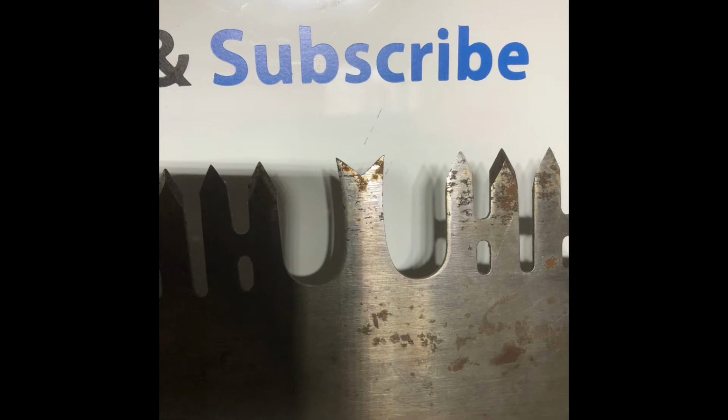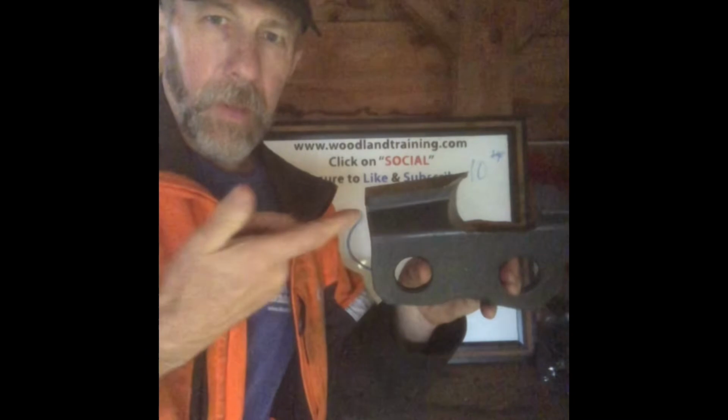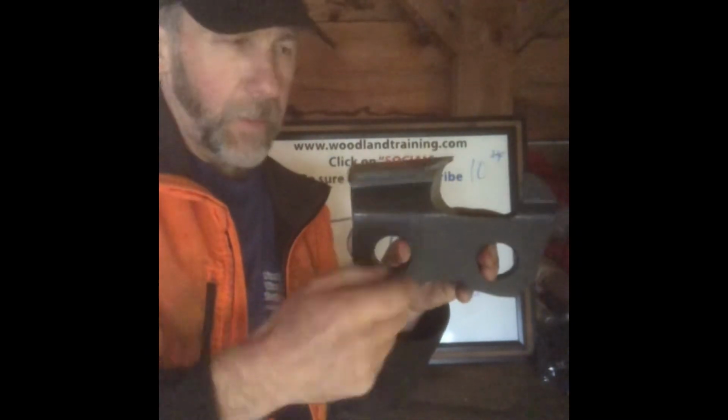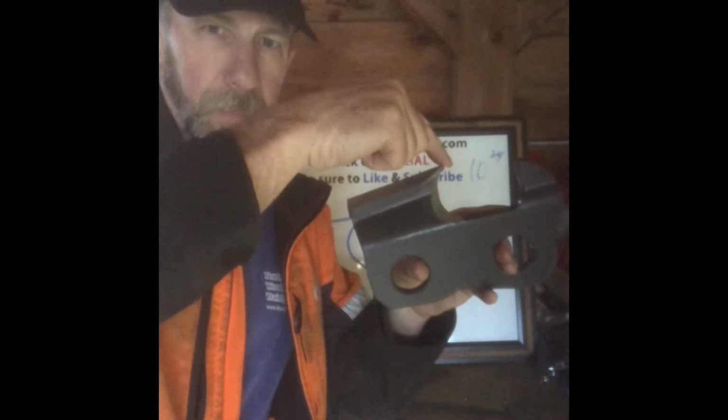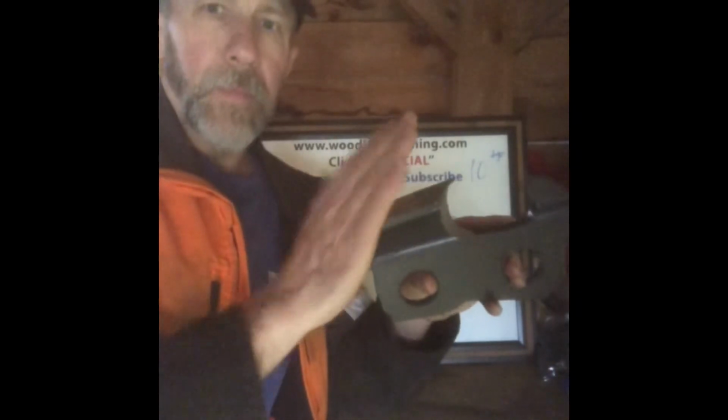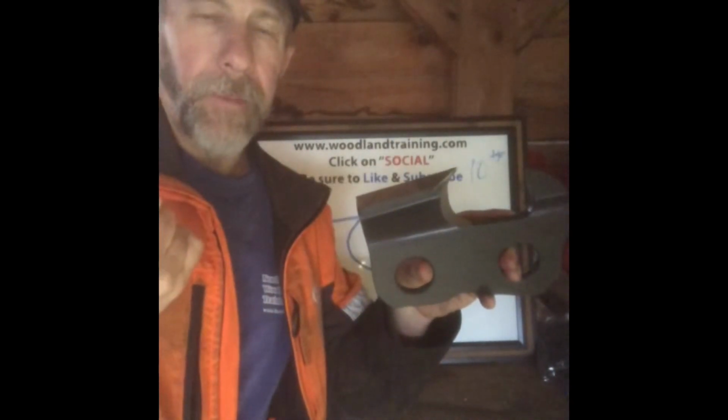Taking that heel off, the chip is going to get out of there a little more easily. When that tooth is pointed back, right? Remember that hooks the point, tips back a little bit. If we don't take that off, that little trap door gets closed a little bit. Grind it off, let that chip get out of there.